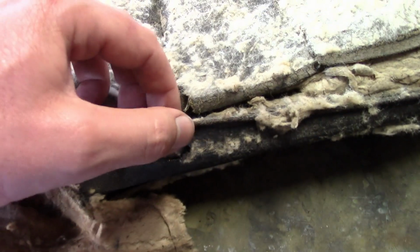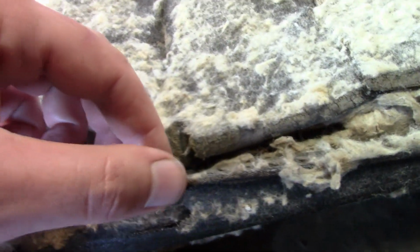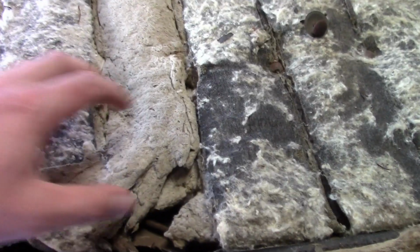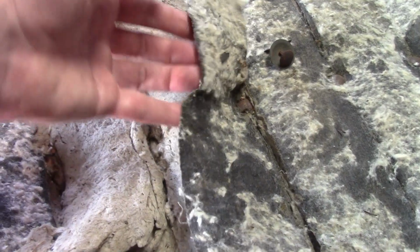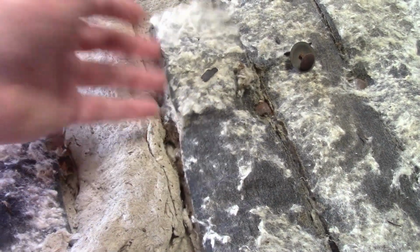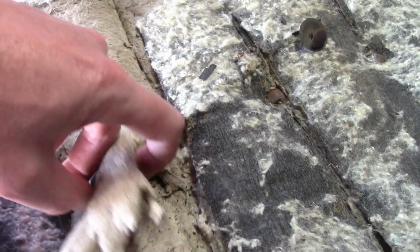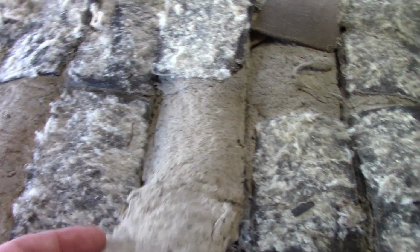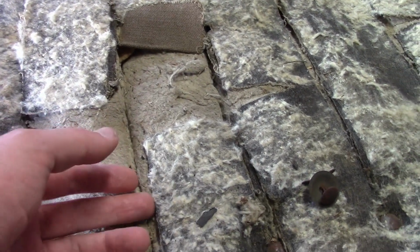Now, first of all, the welt on the edge of the seat is surprisingly small. It's only about 1/8 inch in diameter. It's padded with 2 layers of natural cotton. Now the pleats, they don't have a back on them. They're not piped like the Model A's were, but the top layer of padding was cut into strips to kind of make the pleats look like they were padded.